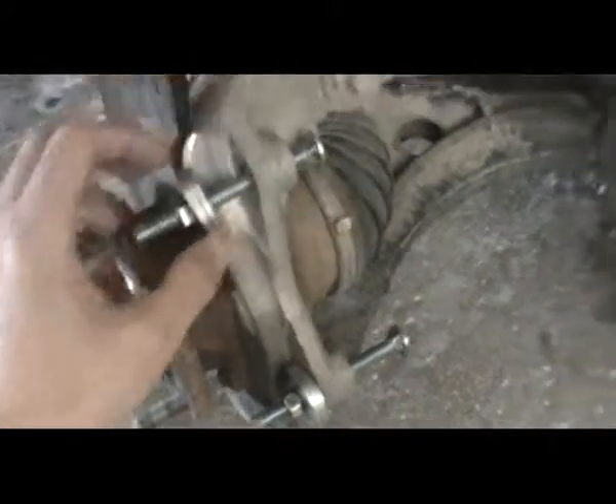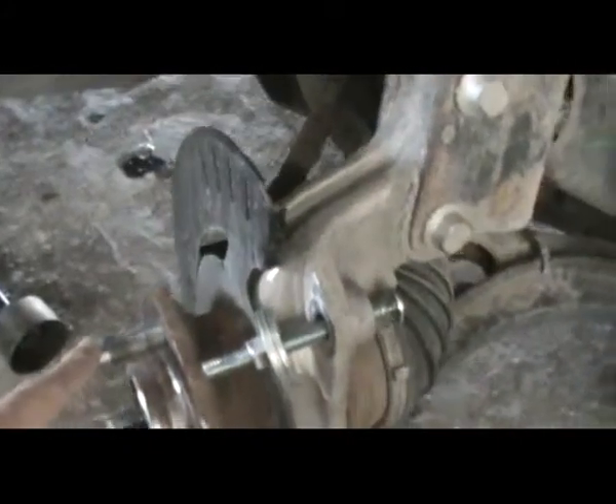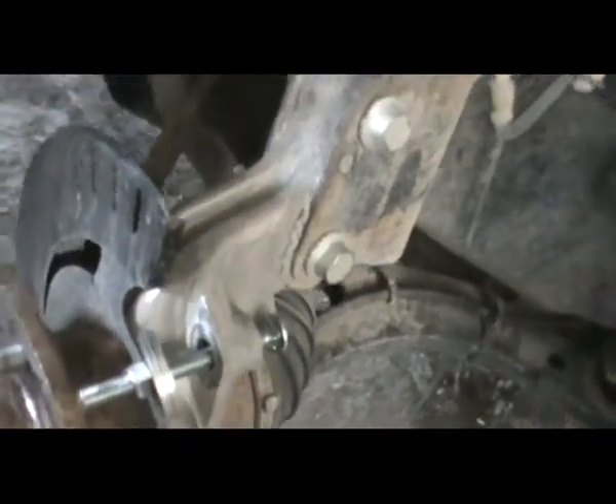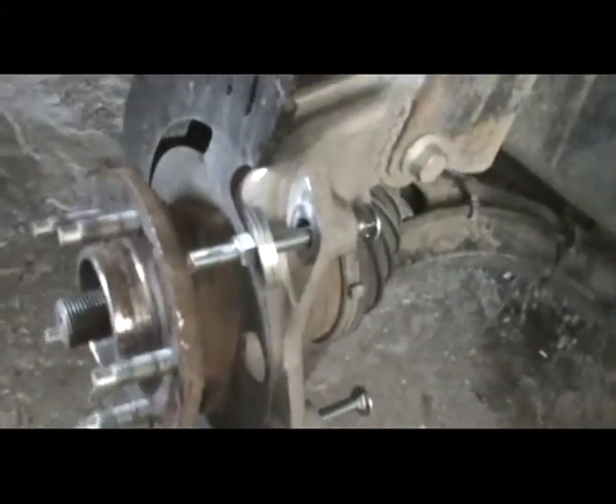Here's the disc — it came off. These are the two screws that squeezed against it and popped it. Now I'm going to remove these screws — this is the hub that we need to change. That hub is held by three screws right behind here. To remove the hub or bearing, there's one screw right here where my socket is, another one right there, and one on the other side. Take all these out and this thing should pop right out. By the way, if you're only changing the tie rods, you don't even need to do any of that — you can just change the tie rod directly, which we'll do on the other tire. But here I need to change the hub.